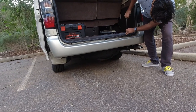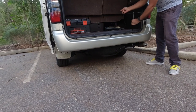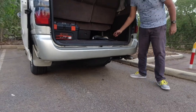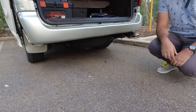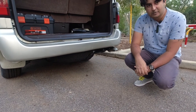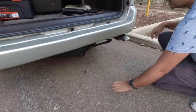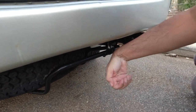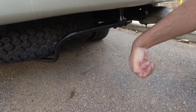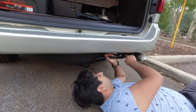Your ultimate goal is to drop the tire just a little bit, because the retainer will not drop the spare wheel all the way to the ground — so there's a little bit of faffing around and you need a little bit of strength. That's about as low as the spare wheel cradle will go. What you need to do is put your strength into it, lift up the spare wheel and the cradle so you can unhook the piece that retains it. This here is basically a claw that holds onto the spare wheel cradle. That claw is connected to the bolt, so when you loosen it the claw drops the cradle down, and when you tighten it pulls it back up. To get the cradle down fully you then have to lift the cradle up.